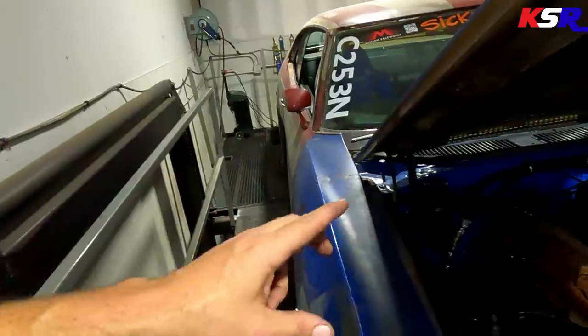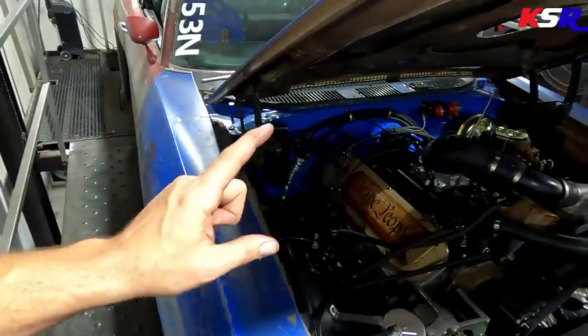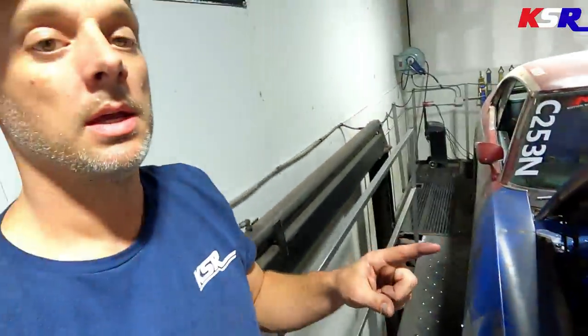All right, so we put two MSD 90 degree boots, the high temp boots, on the back two cylinders. The very back one wasn't hurt, but I still wanted to do the high temp deal. And then we changed from the 45 degree bend on number 6 to a 90. I'll tell you guys, when you're using these Kevlar boots, make sure that they're not making things worse. I think what was happening is, when you push the spark plug wire onto the spark plug, it binds up against the cylinder head, and it was almost pushing it down into the header tube.